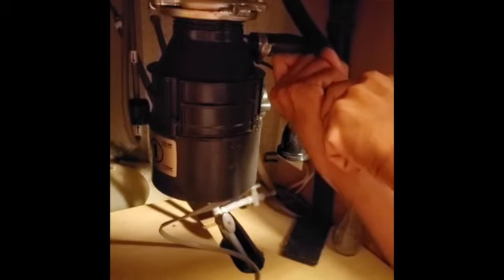Now turn it counterclockwise and make sure it's tight. There's a rail right here, so the teeth have to line up right here. Check over here also — give it a little tug. If it holds, there's another set of teeth like this one right here, so make sure it slides perfectly counterclockwise. Then start putting all the hoses back together, all the way in and tighten. Make sure you tighten well or else you'll have water leaks, but don't over-tighten — just tighten as much as you can and give it a half turn.